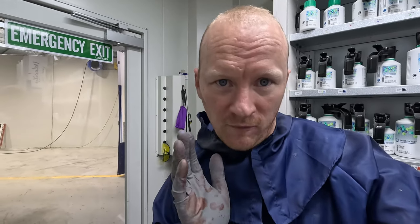And if you've got a different spray booth that doesn't get straight up to temperature, we've got brand new low bake booths here, they're really good, but at one of the places I worked in Perth, it took 10 minutes for the booth to heat up. So that bake time would potentially be 20 or 25 minutes. I really want to make it clear that what works for me may not work for you, because there are definitely some variables. Now that we've got that out of the way, get your bake times right. You've got to find that. I had to find that. Like pretty much everything with this procedure, it's been refined through me. There's no one there telling you what to do. This is the real world and you've got to adapt to what you're working with.